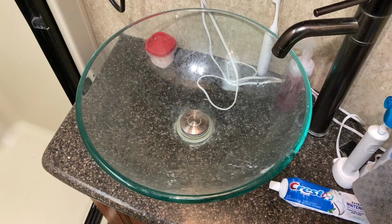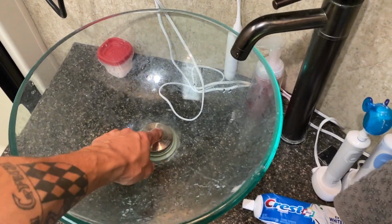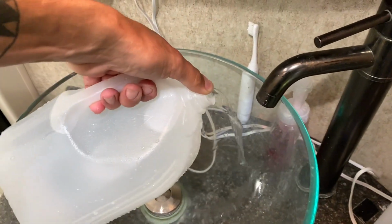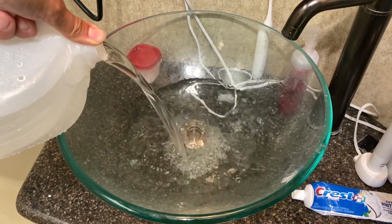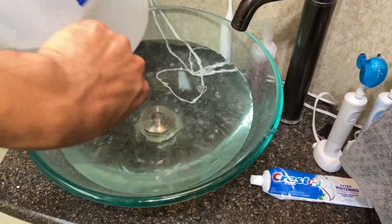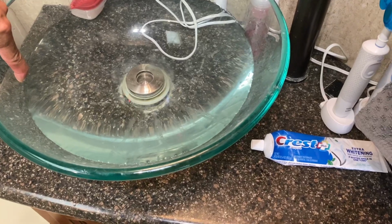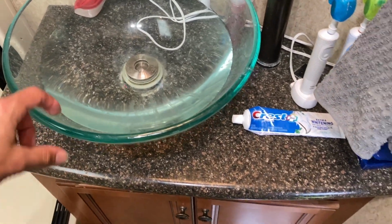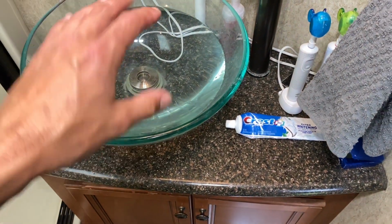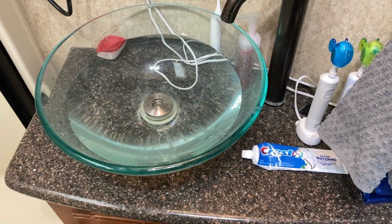my kitchen faucet. Depending on your sink in your bathroom, you might not be able to fit a gallon jug underneath the faucet. So another way of doing it is first go ahead and stop the water, use the existing gallon jug that you just filled up, and we fill this up 1 gallon. Then we can make a note of a mark. You can even just use your finger if you want to. You can draw a line on the outside, whatever you need to do. But I know if I keep my finger right about here, that's 1 gallon. So now I can drain this and refill it with the sink again to that same mark, and again time it, and I'll know how much water I'm using in the kitchen, or excuse me, in the bathroom sink.